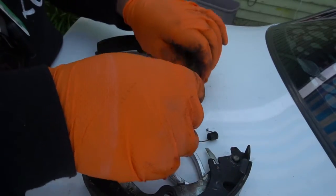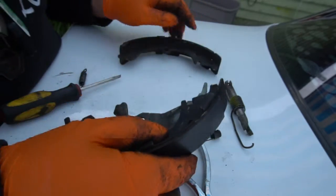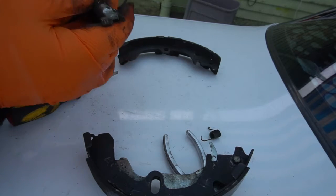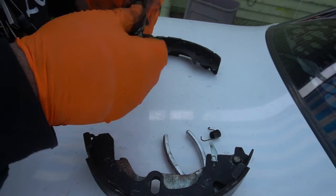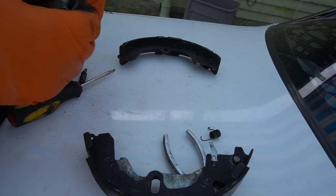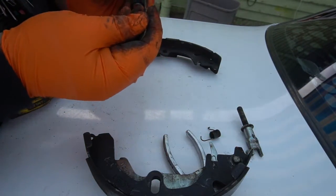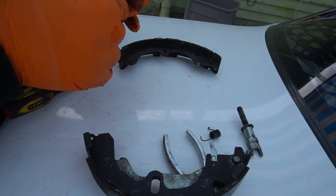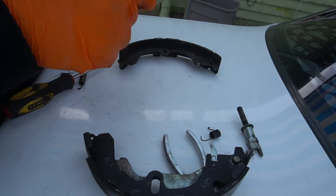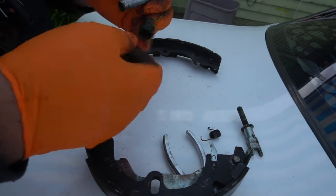You're going to take off our adjusting lever, so that's good. Just remember how it goes. It goes on this side and it goes on that side. So now what we want to do is take off the spring on this adjusting lever. What we want to do is unscrew the adjusting cord. Alright, that's there. Now the spring should just come right out. Just a little wiggle around. Should come out easily. There you go, spring's out.